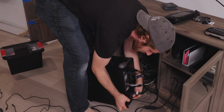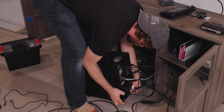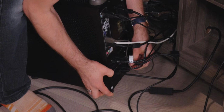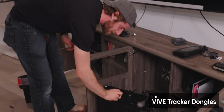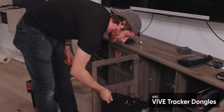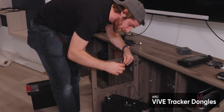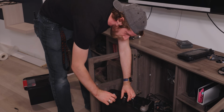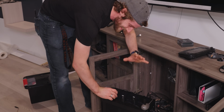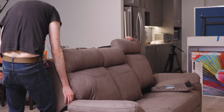Here's something special about this machine. It's got this old, I believe it's made by Sonnet, old USB card that has an individual controller for every one of the 4 ports. Some motherboards might have 2 or maybe 3 controllers, but having more than one of these on a single controller, sharing with any other devices, can lead to unexpected problems. So I've given each of them their own dedicated USB controller. Freaking ridiculous. There we are.